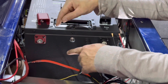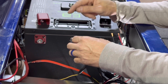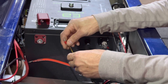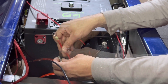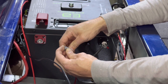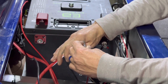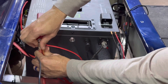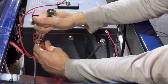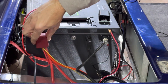Let's go ahead and hook everything up to the battery now. We go in order from smallest to biggest — biggest touching the post. The smallest item is going to be our 12-volt reducer 48-volt input, next we have the positive from the existing 48-volt reducer, then positive from our onboard charger, and the last item going to the post is our main positive cable from our solenoid. Go ahead and use your 13mm wrench to tighten down the terminal hardware, then replace your terminal protector.